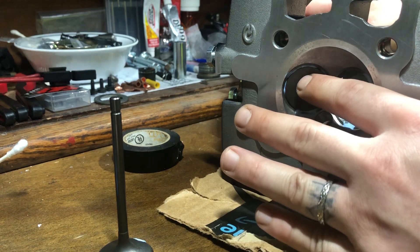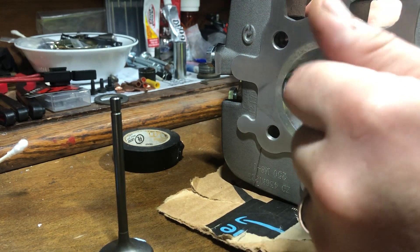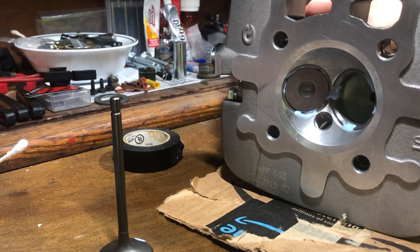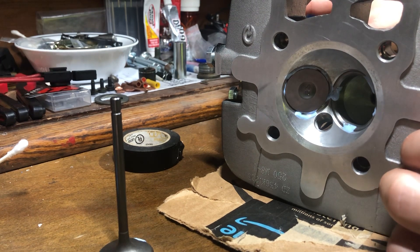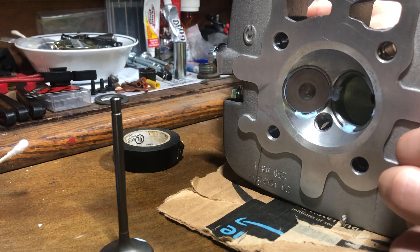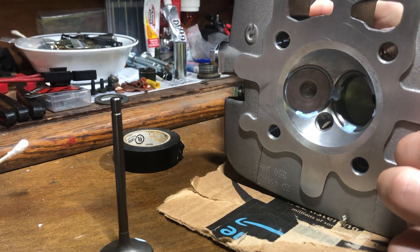Personally, I recommend doing this by hand if you've never done it before. Use a little suction cup on the valve side, spin it by hand one way, then spin it backwards. You'll hear the grit in a sanding action. Once the grit lets up, let the valve come back out — you might have to add more compound, or it might be done.